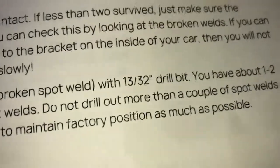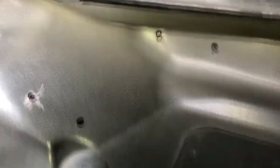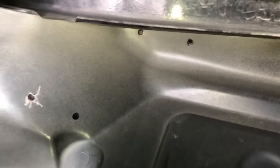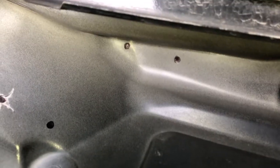These ones are apparently much stronger than the other two. Let's start off with this one here — drill it out with what it says to be a 13/32 drill bit, then fish in a wire and get my bolts and fish it through. I've marked the four points I'm going to drill. I'm gonna start off using a small drill bit, probably a 9/64 or like one-eighth, just to get a nice guide hole through it, and then go with the 13/32 drill bit. I'm gonna start with this one on the left.